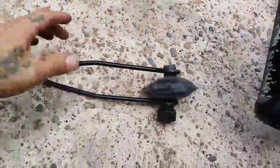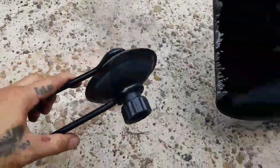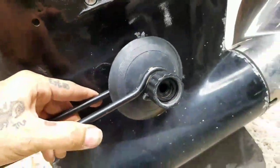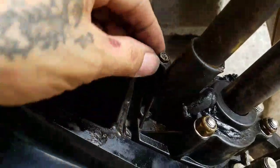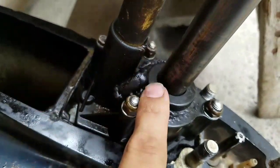If you're going to start your boat at your house before heading out to the beach or to the water, be sure to always have some of these handy. They connect onto your water hose like a garden hose, and they just slide in from the back of the transmission all the way to these holes right here. Turn on your water and then you can start your boat.